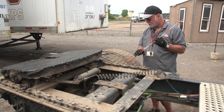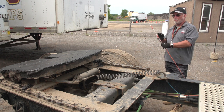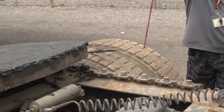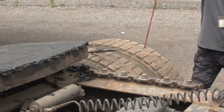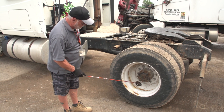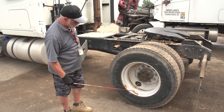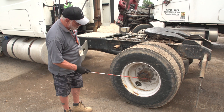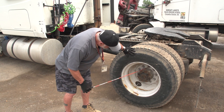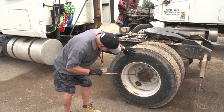We've covered the brake system and the drums. Now we go to the tires. Inside and outside of my tires — all of them — have no abrasions, bulges, or cuts. They are all evenly worn and have at least two thirty-seconds depth. I will look for my tire stem: it's secure, not cracked or leaking, secured by a cap, and I will check it with my tire gauge. My rim is secure, not cracked or broken, no illegal welds. All my lug nuts are secure, not cracked or broken — I do not see any rough spots or shiny spots indicating a loose nut.